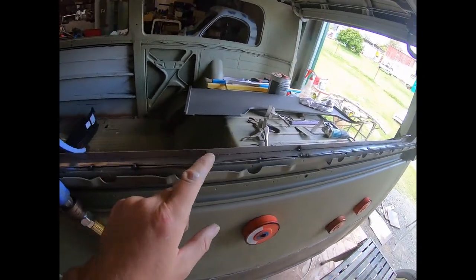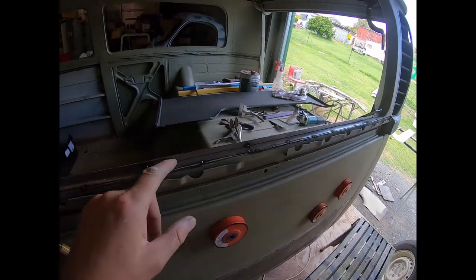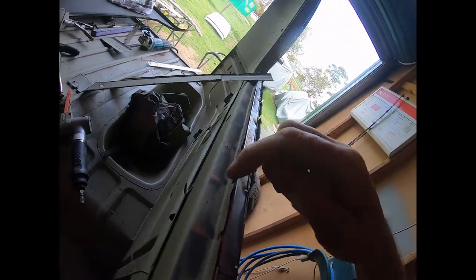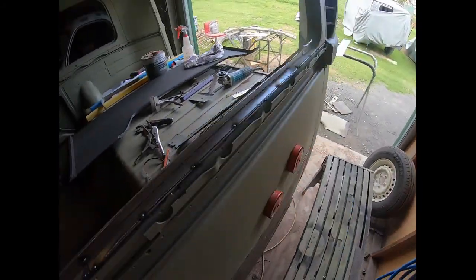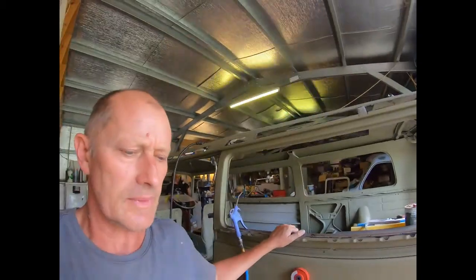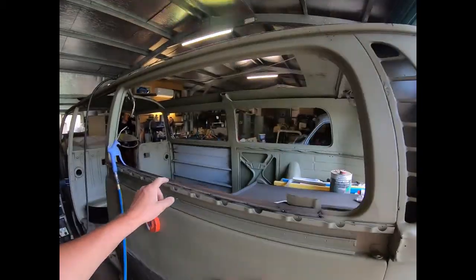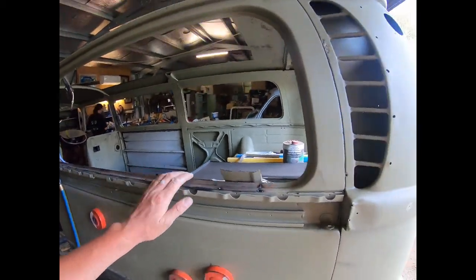It's like all these pieces put in here, it's all coated, and the back of the inner lip there, it's all sprayed with copper spray weld through primer, so that you just create as much protection as possible. Some areas where you overlap and that, you can't do much with them.